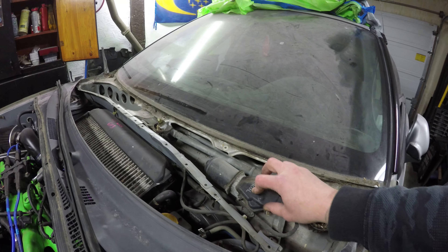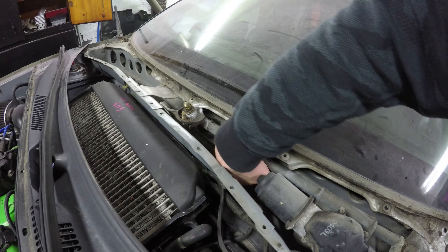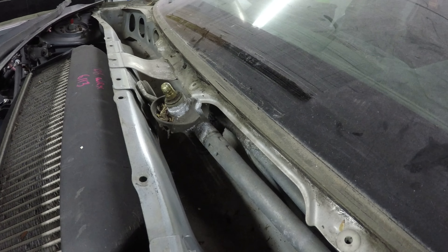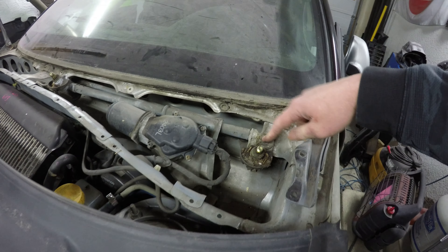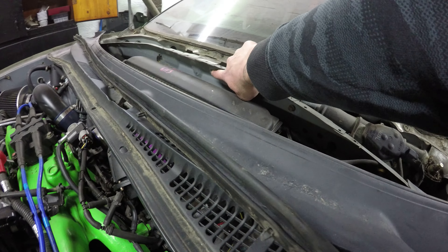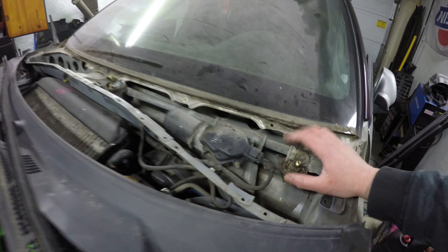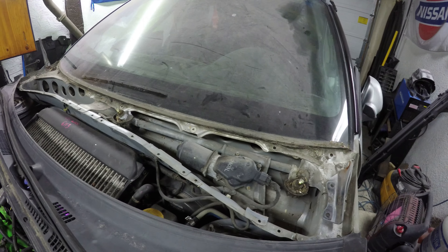Getting down to the assembly I got a better idea — it seems the linkage has come loose. You can kind of see how much play is in there. All I've got to do is unplug it, there's one 10mm bolt here, one further down here, and one on the other side of the firewall, and I think it will come out after that. I'll get it out, get a better idea of what's going on, and then get ready to replace it.